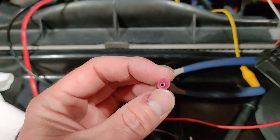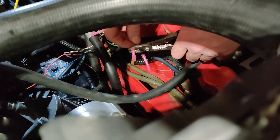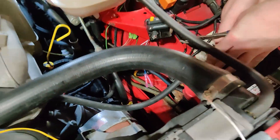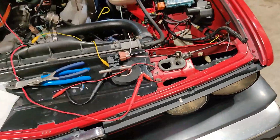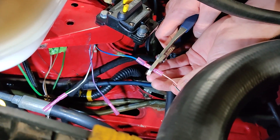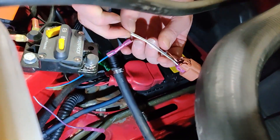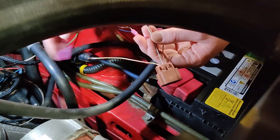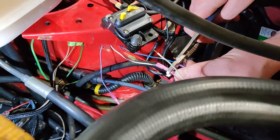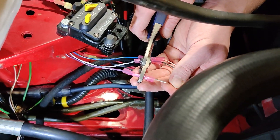These fittings are 20 gauge — you can find them on Amazon or eBay; they're just a heat shrink butt connector. This Carlisle stripper and crimper combo set of pliers is amazing — I highly suggest them. A lot of different companies make similar tools. The pink wire on the end of the sensor is for power, the white with a black stripe is for sensor ground, and the white wire on the end is for the output to the Mega Squirt for the actual flex fuel signal. Just make sure you have a sensor ground and not a chassis ground.